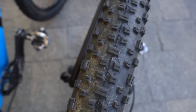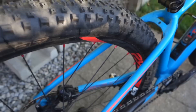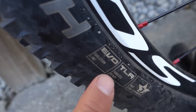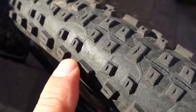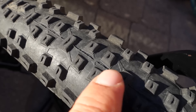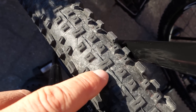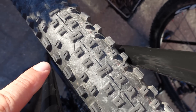As a rear tire it's good, however the Thunderbolt for me works just as well and is a bit faster. The light skin version is not losing air yet, however you can see the sealant seeping through the sidewall, so after a season of use this tire is probably about done from that standpoint. In terms of wear, you can see a bit of wear on the side knobs, the rolling knobs are a bit more rounded and don't have sharp edges anymore. On this one you can see more pronounced wear on the rolling knobs and also small tears on the cornering knobs.